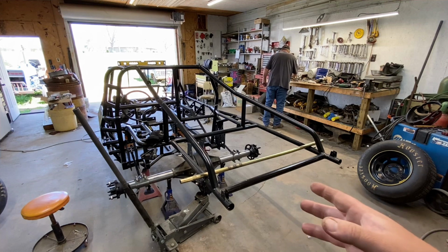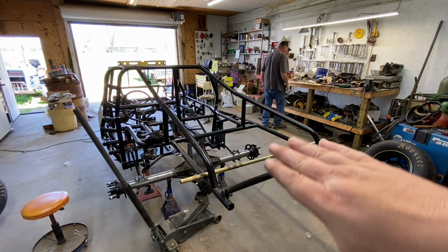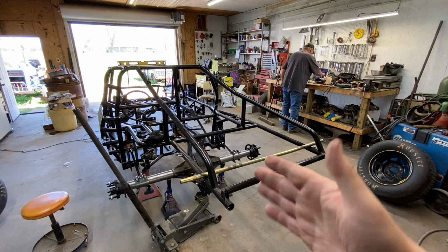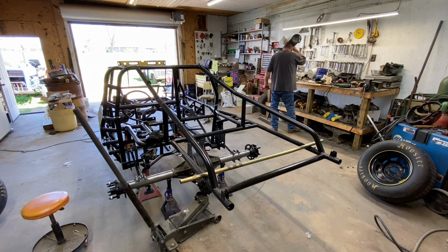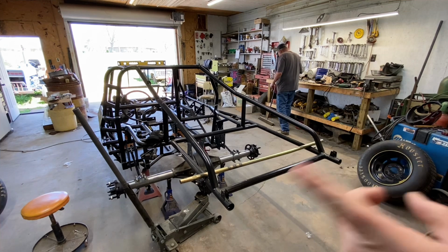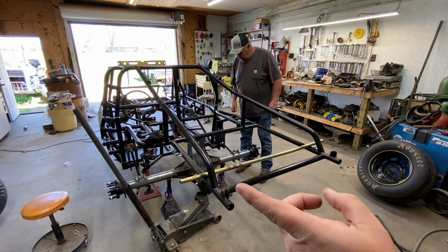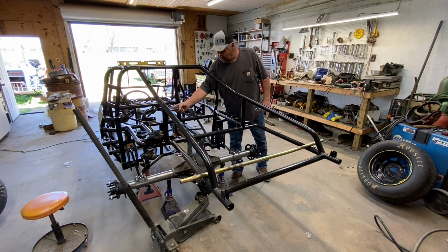And then keeping the rear end center, but a lot of times what we like to do is put the car in dynamic and then center the rear end, center the pinion. So that's how we like to do it. I know that may be wrong for some, it may be right for some, but that's just how we've made it work. So we're gonna get that J bar bolted on, and then here in a minute, I'll probably throw it back up on time lapse while we do the pull bar stuff, cause that may take a little bit cutting that and welding that. So if it ain't right, it ain't wrong. That's right.